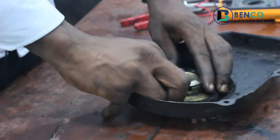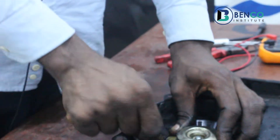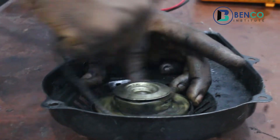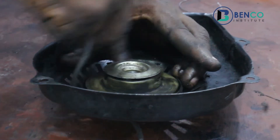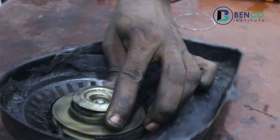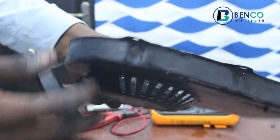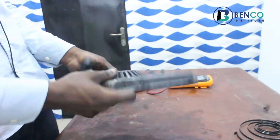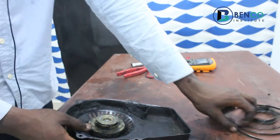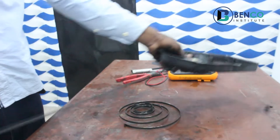The rope has not entered fully. So what do we do next? You go back, take the rope, hook it back to this particular spot which we did earlier. Then rotate anti-clockwise for another two to three times. You see it now? So we've successfully changed this back spring - that's been the fault of this the whole time - and replaced it with a new one.